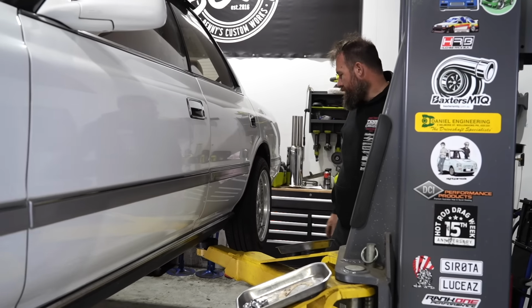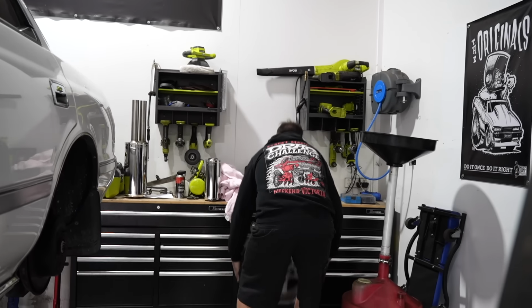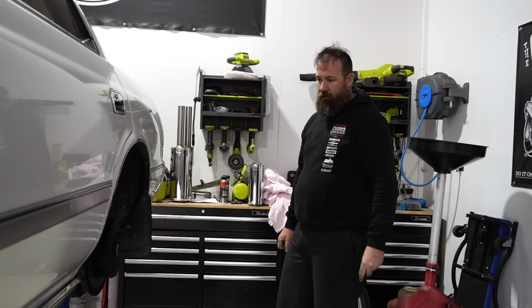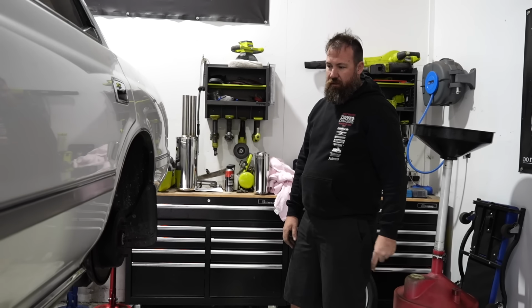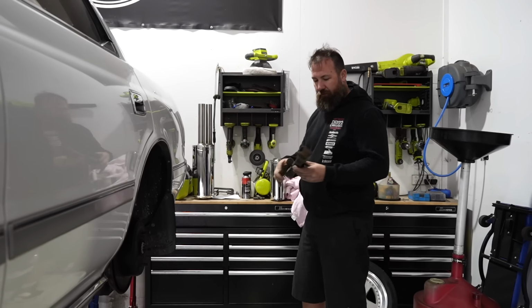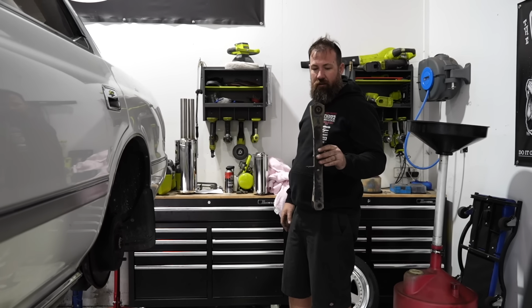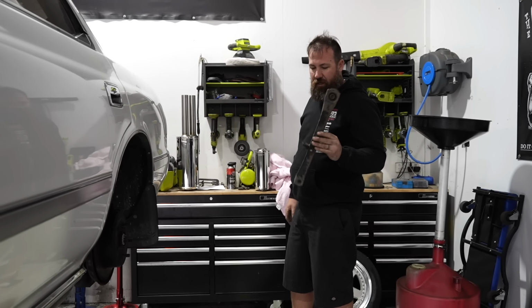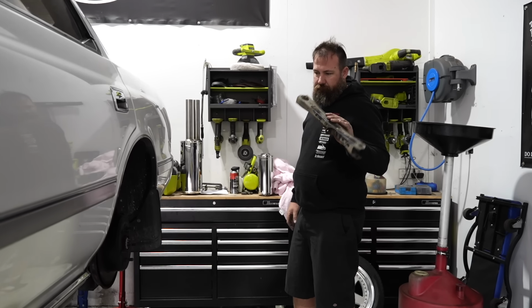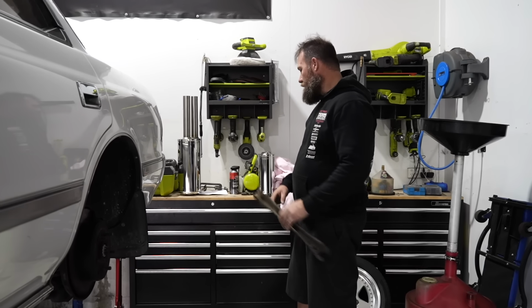And then, just to be sure, at the end, you're even checking by cracking the nipple on the front? Yeah, no, we're not doing anything brake-wise on the back. I'm literally going to fit the MX-83 rear lower control arms because these have a sway bar bracket. The GX-81 doesn't have that. So we're going to whack them in now so that we can use them with our sway bar that we're still developing. And I'm going to put different wheels on the back because I'm going to sell the wheels that are on the car currently.